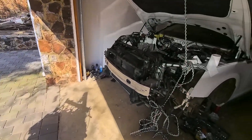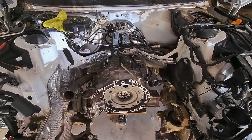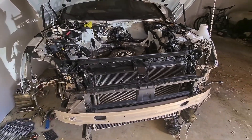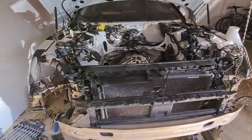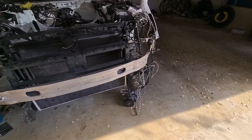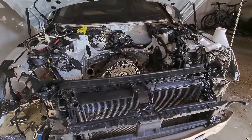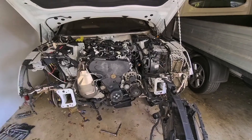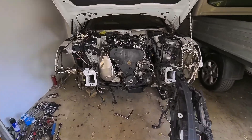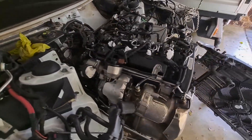Ready to go back into the car. This is the quattro transmission. On the Audi it's very easy — this whole front end is a modular front end, so just lock it out there and swing it across. You don't have to loosen the air-con pipes; there's the air-con compressor lying on the ground, don't have to recharge the air-con — just swing the engine right in. There's the motor back in the car; now it's just to connect everything.